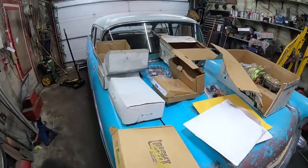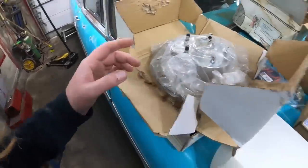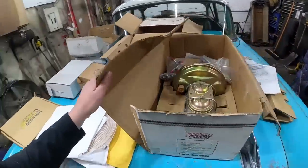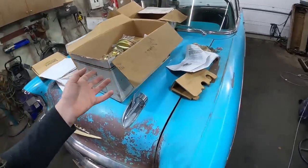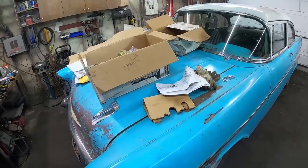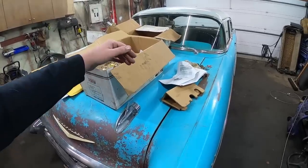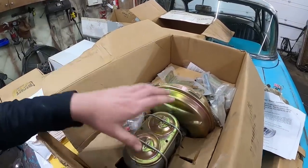So the car's in the garage. I brought all this junk out of the basement which I actually had sitting outside for a while, so there's a few leaves. This is the kit I ended up getting - it's a Right Stuff kit. It's just a power front disc, now it's a nine inch booster. I know they made an eight inch as well, but when the guy was building this car originally it was going to be a small block car. There's lots of room. Now I know what the LS is, and with those side covers I have, I'm hoping this will still fit. They do sell a little piece that moves the master over and up, but I'm hoping it'll be okay. I do have those slide mounts and when I put the motor in the car I did have it as far ahead as I could, so fingers crossed I have enough room.